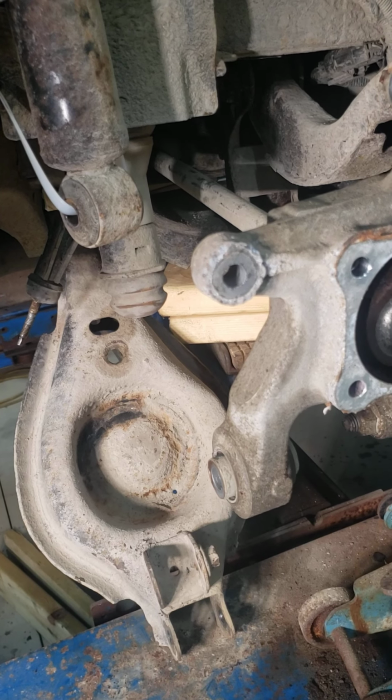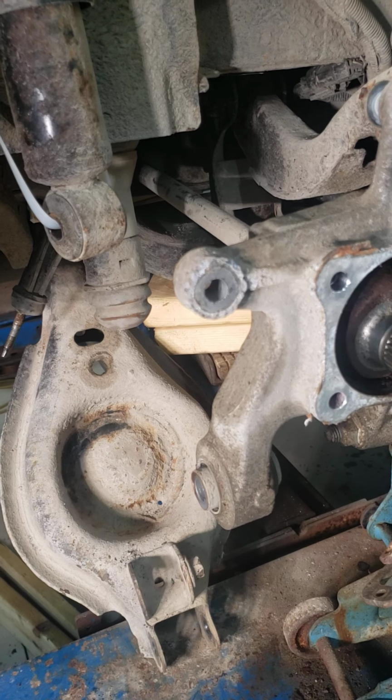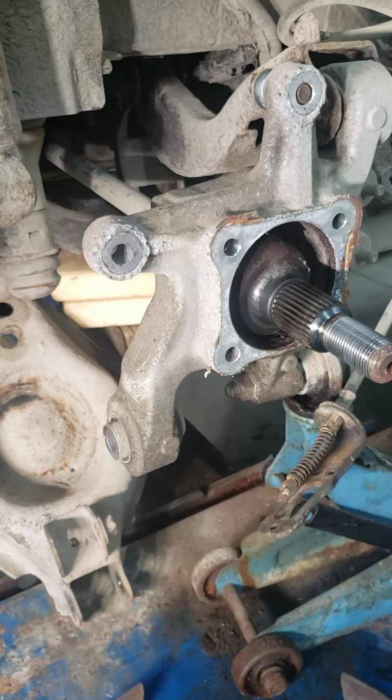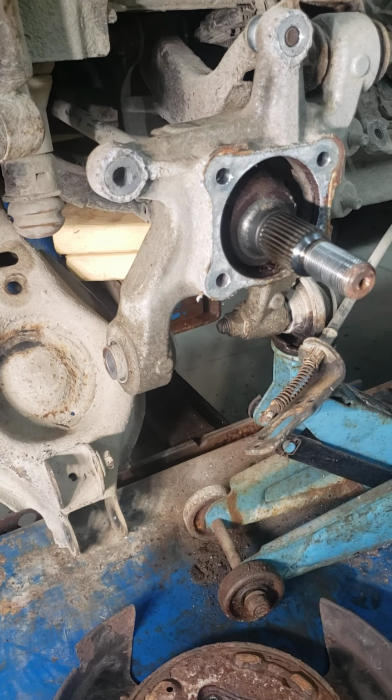Because the bolts are in so tight, you have to use an impact wrench or have the ability to get a breaker bar up in there to get them off. And I still sheared one, even doing it that way by hand. That wasn't the impact wrench on the one that broke.